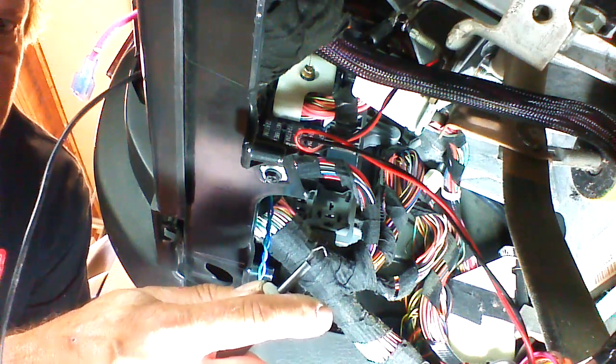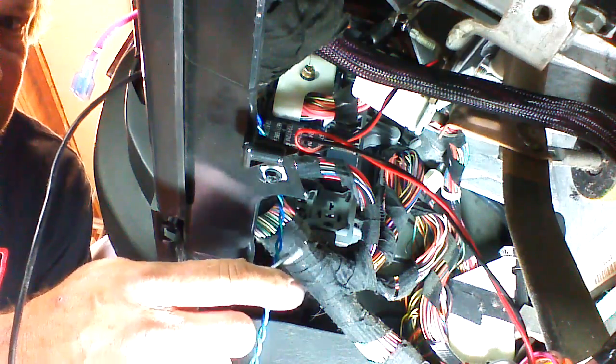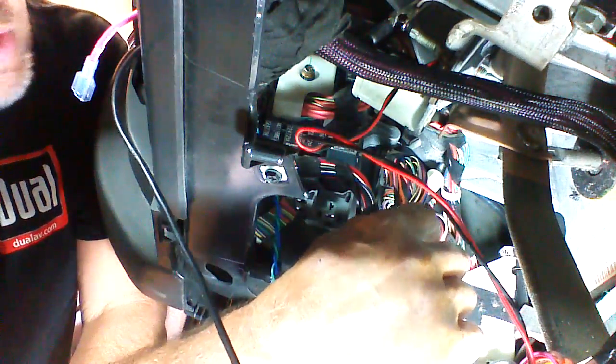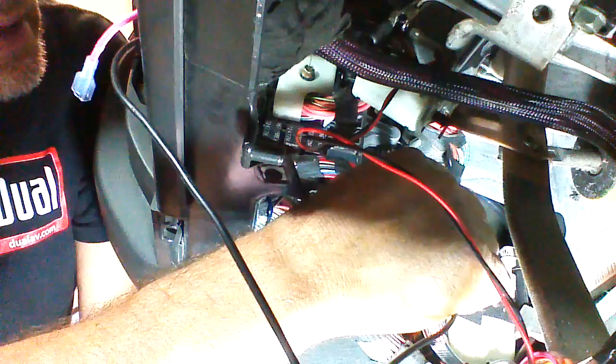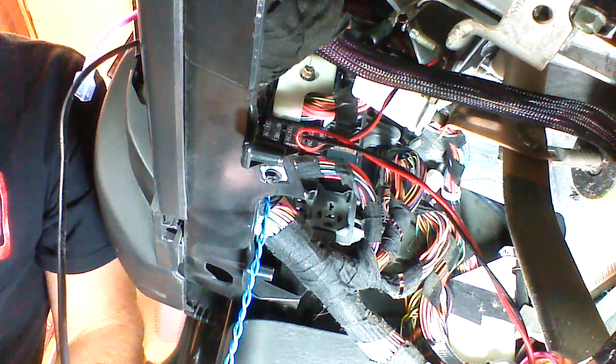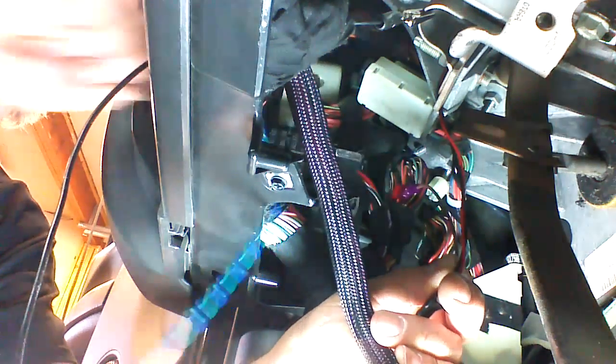And if the hatch is already released, when you probe it, it will not release again, or you will not hear anything. The hatch has to be closed when you test it. So we have our hatch closed. We're going to apply a negative, or ground this wire with our test light. And I hear the hatch open, so we're going to connect our brown wire from our Crime Stopper directly to this connection. Okay, we have our connection to the hatch release done. I'm going to go outside and show you how it works.